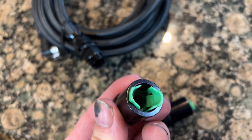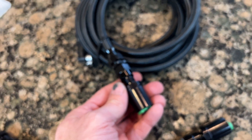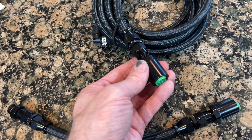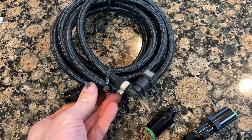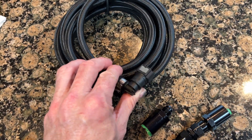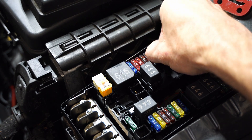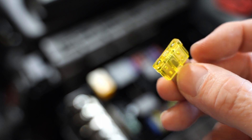They haven't actually put this to market yet, but it's coming. It's two parts: I have the fuel line that runs from the fuel pump to my ethanol sensor — that's what the quick connect is for — and then that smaller section goes from my ethanol sensor to my MPI fuel rail. Because I don't have my final MPI rail, I'm only going to be installing that big line, which I think is really the challenging one, and I have a tip for you that will help a lot.